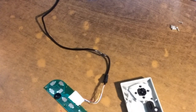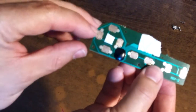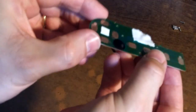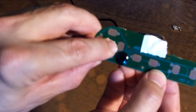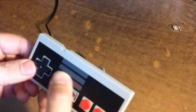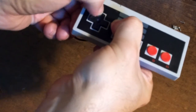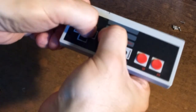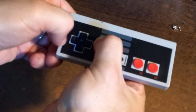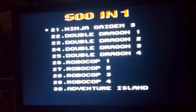I'm going to put a few pieces of tape right in the center of the four direction pads, just so that the D-pad itself can rock back and forth and not touch everything at once. I'll get some scissors and some tape. I just cut four little squares of tape and stuck them in the center of the four pads — that's just to give the D-pad something to rock on. Let's see how it feels before I put the back on. Still moves pretty good. Put it back together and try this one out — let's see how Pac-Man works now.